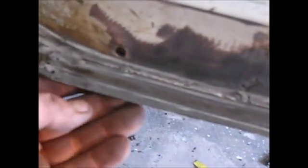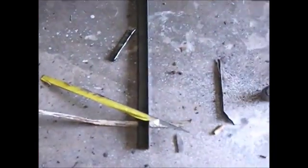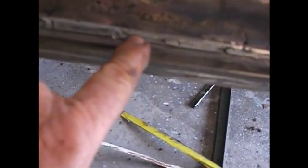And I got our bead in here. I got spot welds going, one right there, right there, right there, right there, right there. And once I get the skin on it, I'll probably zip right across that little seam right there, grind it all down and seam seal the whole thing.